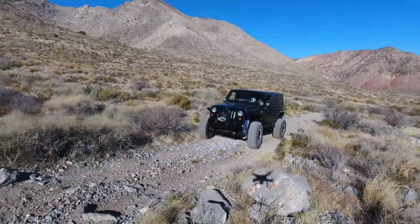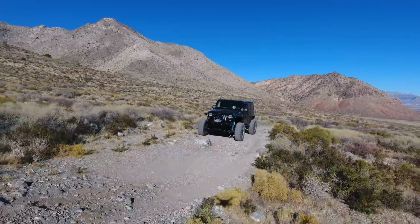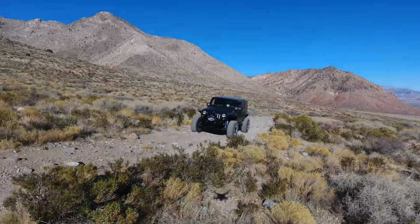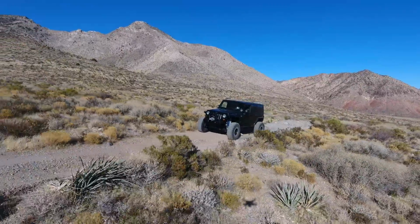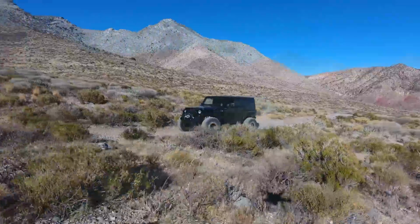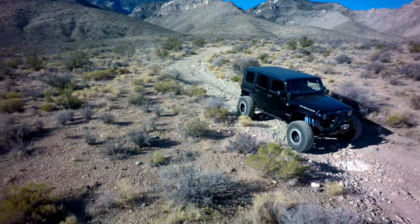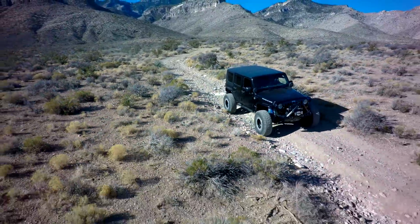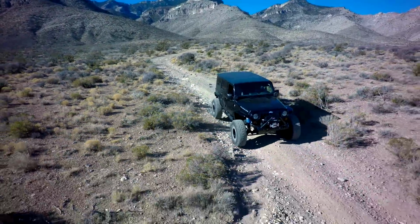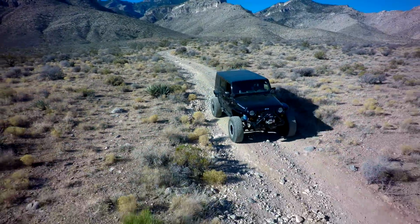In 2009, they took the L92 and they added flex fuel and called it the L9H. That's what I'm driving right now. It's an excellent engine. They continued production of the L9H right up through 13 or 14. However, it was overshadowed by the L94, which came in 2010. The 2009 L9H is all aluminum, VVT, and flex fuel. They did change a lot and upgraded the operating system in 2009.